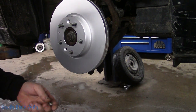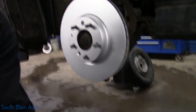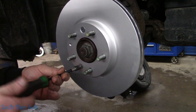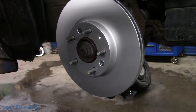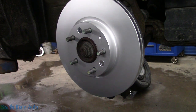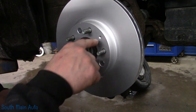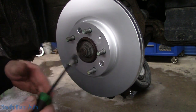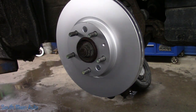A couple of times I've had to wail the piss out of a brake rotor to get them off, and you always get the comment from various viewers - I'm assuming non rust-belters - and this is what they say: 'Bro, you ever seen that screw hole in the rotor that's got threads in it? You just need to stick a bolt in it and that rotor will pop right off.' I understand that's the theory. It's like an eight millimeter hole. You take a bolt and in a perfect world you stick it in there, give it a little screw, and out she comes. But if you've ever tried to use those, you know that immediately the hole just strips out. The threads are in cast iron - they're not very strong, there's only three threads there. If it's just a little bit stuck, that'll probably help you. In our situation, not going to happen. Prior to the explosion, I'd already cleaned up my caliper brackets. Had to open up a fresh can of extreme Permatex - a lot of folks ask what I use. Opened her up this morning, had a couple two three brake jobbers this morning.